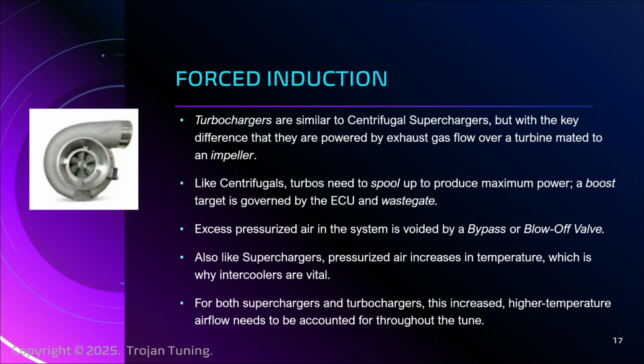Over time, as the four-stroke cycle is used in a power run, right? So if you start at wide open throttle even, and that period of say 7 seconds where you're accelerating like a madman, that is a wide universe in the car world. This four-stroke cycle will happen hundreds of times, right? And over the lifetime of those events, the temperature overall is going to go up and up and up, right? And if you begin getting into the world of forced induction, your cylinder temps are going to go up dramatically. The opportunity for detonation increases dramatically.